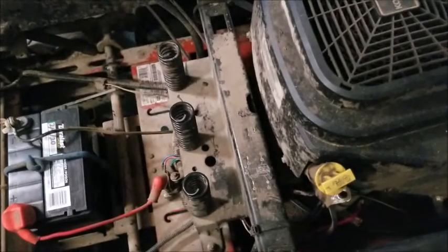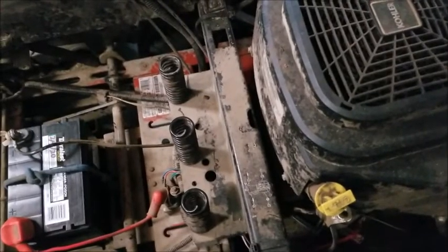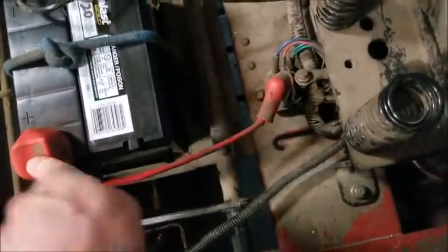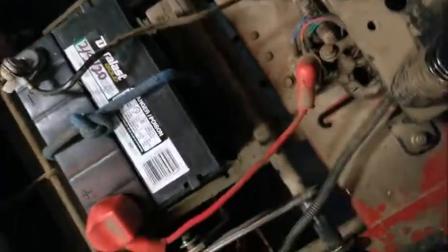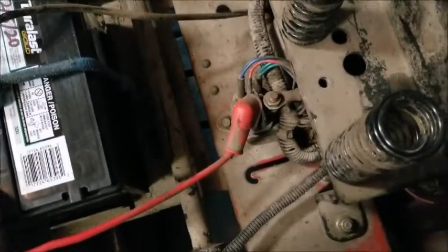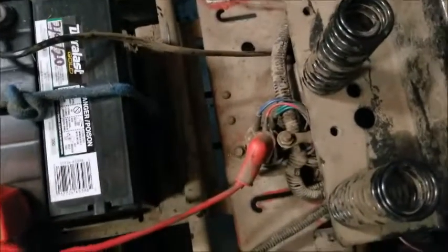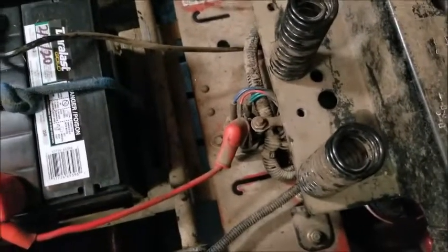I'm not going to show how to do the whole jump-start thing. You can use a wrench, but I don't really like that because it creates sparks, which is a hazard. What you can do instead is disconnect the negative battery cable, disconnect the red wire from the solenoid, plug the negative back in, and then touch those two together. That's a better method than the wrench. But personally I don't need to jump it because I have a power probe — that's what we're going to use today to test this solenoid. I already know what the problem is; I just want to show you guys how to do it.